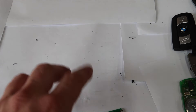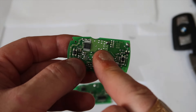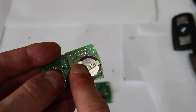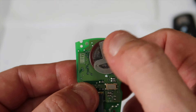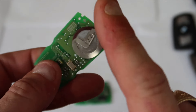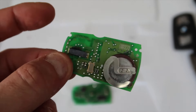The soldering of the battery does take some skill since not everyone is comfortable with soldering, but it is a simple job to solder those two points and remove the battery. Make sure you buy a whole new one with the casing — this is the rechargeable component. This is the bit the ring on the car touches to recharge that battery when it's inside the ignition. This is why you need to change the battery if it's fully dead, because it recharges from this ring.